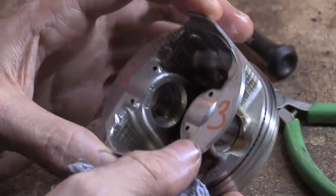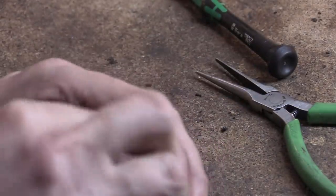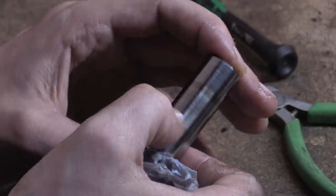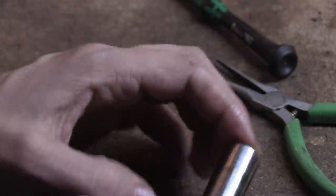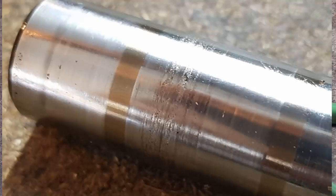Burn marks on the underside — looks like it's getting a slight bit hotter and this region is larger. Similar wear on the wrist pin bore. However, I noticed when taking them apart that things seem to get worse the further right we go. You can see the galling on that one — it's starting to go through the hardened material and gall really badly. It's also to one side. I think what's happening is the end-play on the crankshaft has shifted over time, causing asymmetrical forces on the rod.